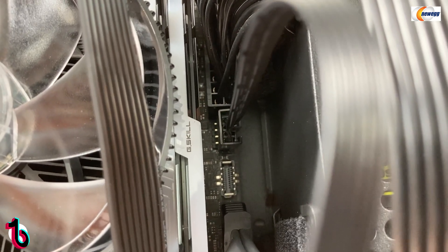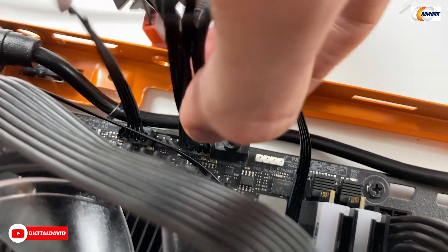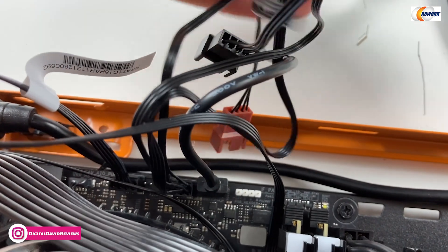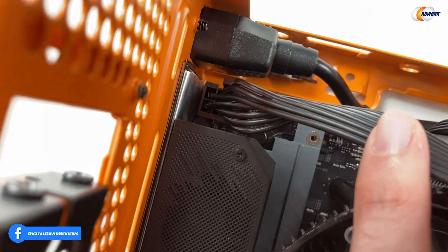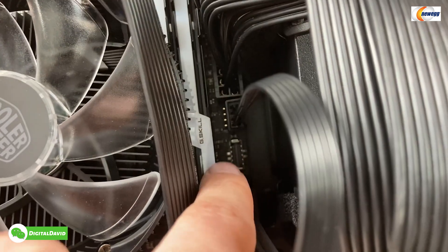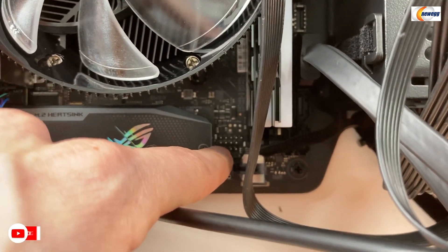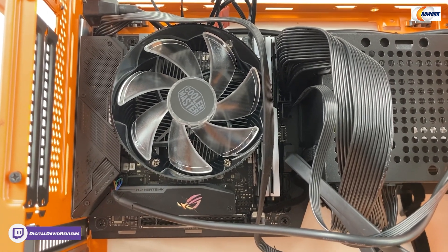We have our front panel connector pushed right down in place — really nice. Then main power supply. We have our 5-pin splitter for our RGB, then our chassis fan with an adapter so we can attach both fans to this motherboard. Then you can see where our CPU fan is installed, and lastly our connector for CPU power from our power supply. There's also USB Type-C if you have that connection for your build, and our USB 2.0 connection as well.